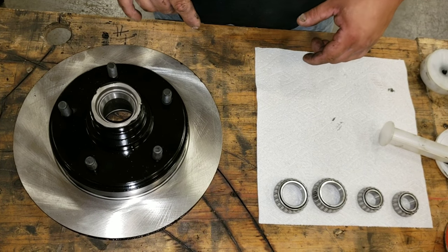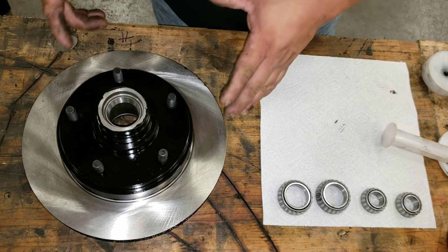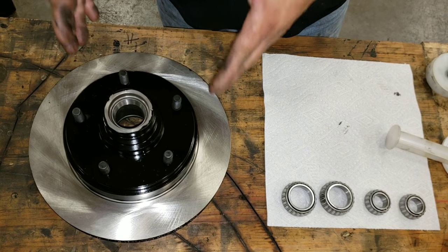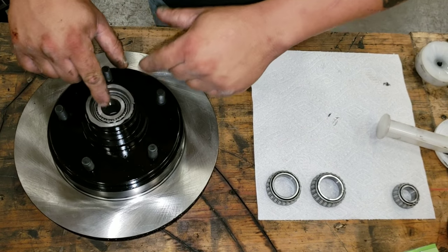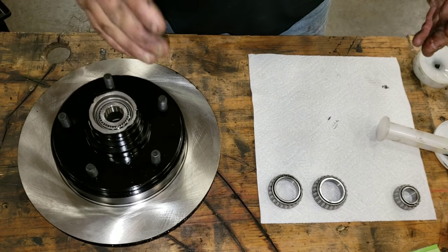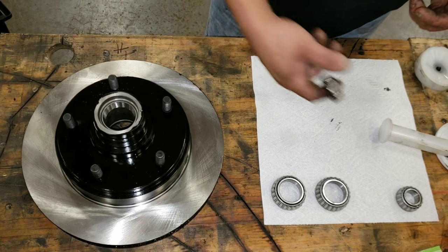If you take your rotor off and send it out to the machine shop to be turned, you have to make sure that the bearing that came out of the left side goes back in the left side rotor, because the wear patterns are going to be the way this rotates in that race. Eventually it makes a wear pattern, and all wear patterns are different. If you put wear patterns that don't mesh exactly, they wear themselves down quick and you make your bearings loose.